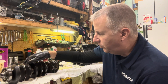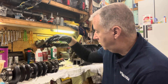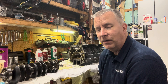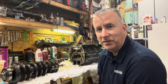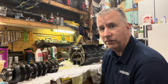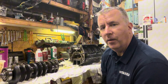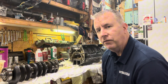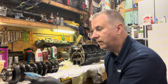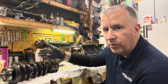We have really good bearings on this machine. But in the kit they do send us two new center bearings and new end bearings as well. I like to save the end bearings and the center ones too usually. But the guy said this did have a knock — we're assuming it was from the pistons, the two pistons that were causing that problem. When we spun the crankshaft after we took all the connecting rods off of it, it spun freely and there weren't any problems. So usually I don't go ahead and change that, but on this one, since they gave us the new center bearings, I'm going to go ahead and see what they look like and if they're different. And we're going to lube all of these bearings with my Shell Rotella — even though this still has some two-stroke oil in it.